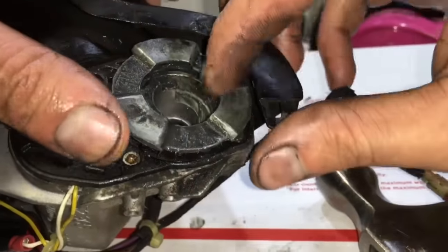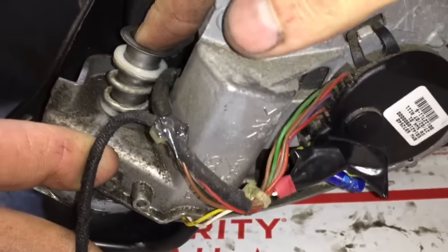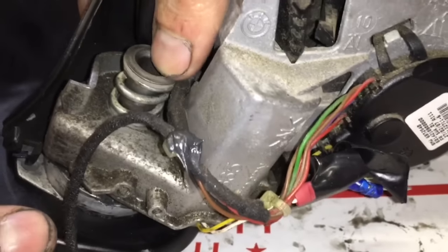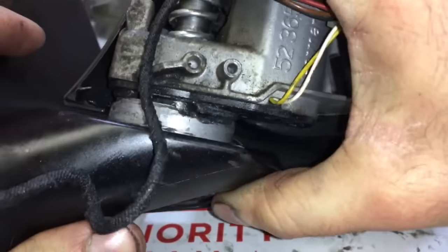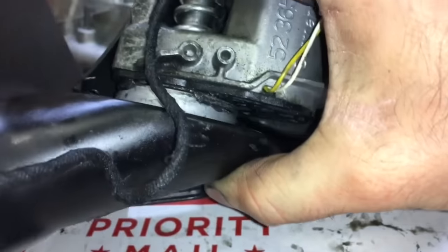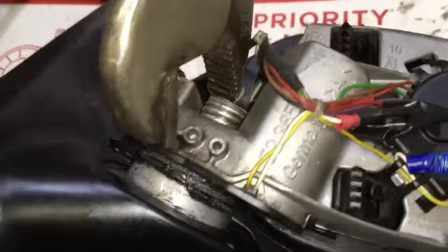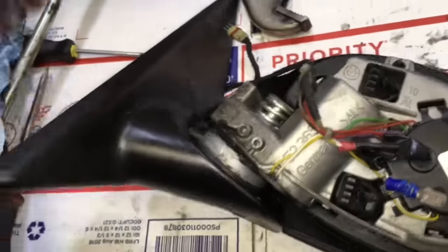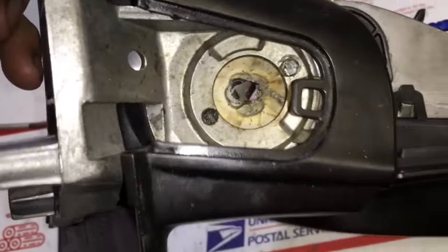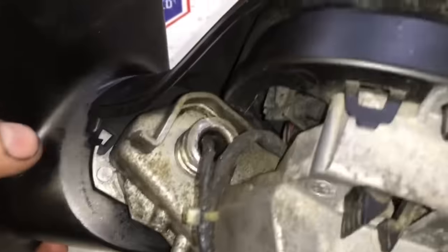After that, you can put this little thing in there. Make sure your two plastic pieces are there and the spring. And then you will have to compress that with the vice grip and weld a washer on the back of it. If you weld it like I did, you will have to go back and port it out some so that the plug will go back through the hole. Don't forget to put your plastic cover over the underside of the mirror also.